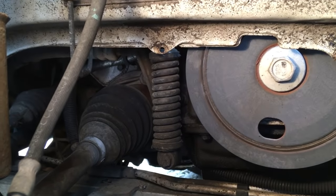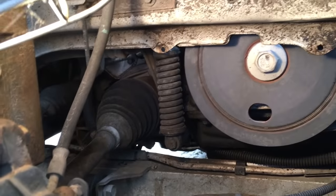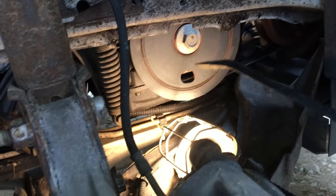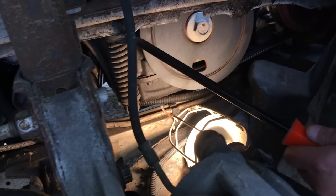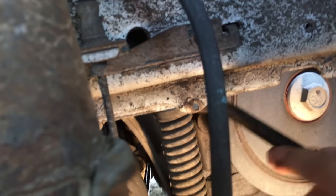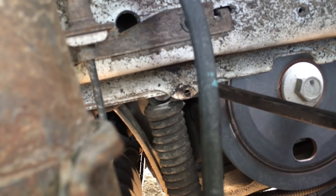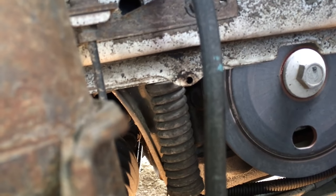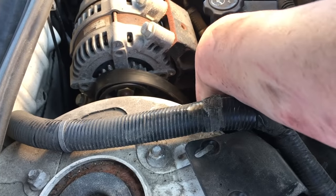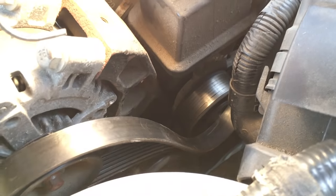This right here is the belt tensioner — a crazy way to get to it. I'll include a link to the YouTube video that showed me this because he does a better job of explaining it. There is a tool you can get from your GM dealership that costs $100 that nobody keeps in stock. Being that we don't have $100 and three to four weeks to wait for it, we're going to use an average pry bar. Get it all the way up in there until you get it on the top of the spring, then pull it down — that's going to loosen up the tension on the belt.